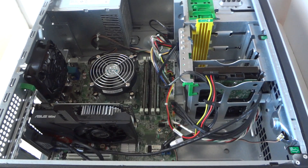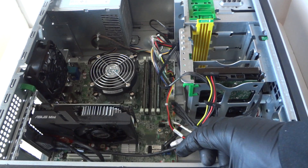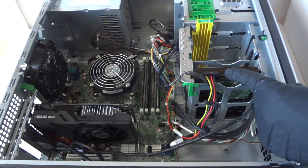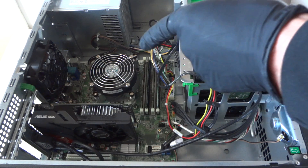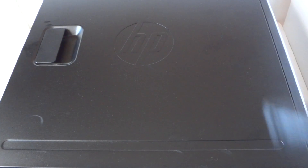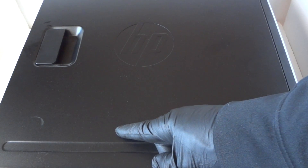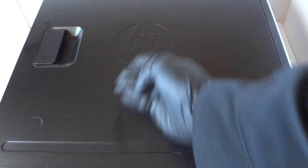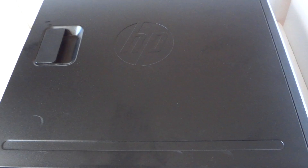There's a little PCI bracket secure lock where you clip it back in. So we've now upgraded the video card, the solid state drive, and the memory. Close the side cover panel back on. When you're done, go to nvidia.com to get the drivers for the video card — choose your operating system, Windows 10 64-bit in this case — install the drivers, connect your monitor, and restart the computer to get the video card working properly. That's about it — this is the HP Elite 8200 convertible mini tower. Thanks for watching.